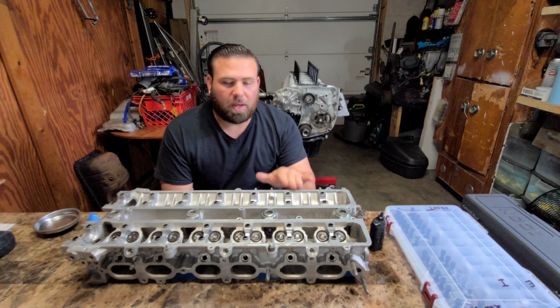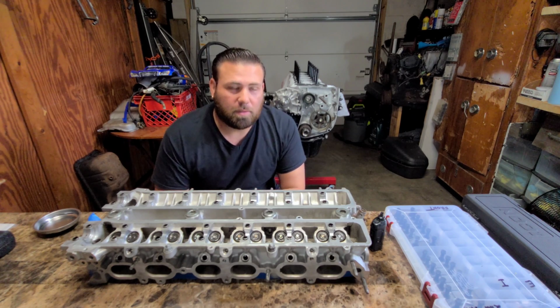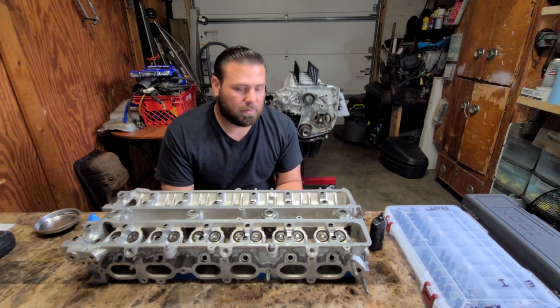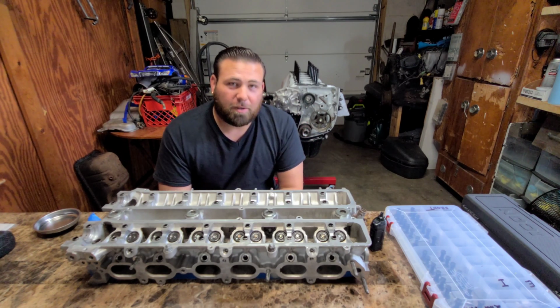The original torque specs for this engine were insufficient, which caused most of the head gasket failures on this engine. Taking precautions, make sure this one doesn't have a head gasket failure. So ARP, MLS head gaskets, that'll do the job.